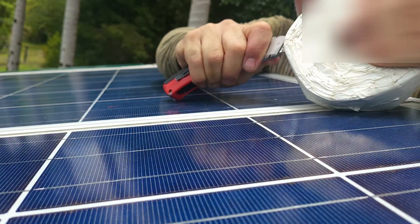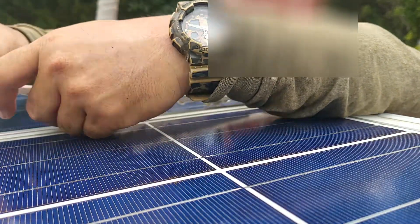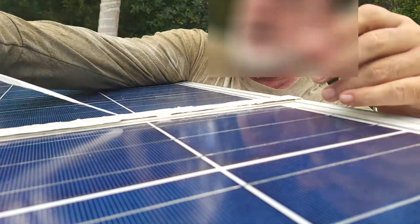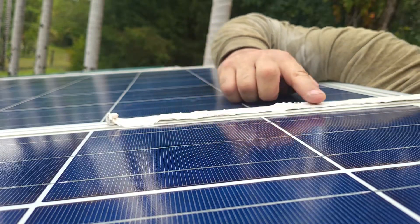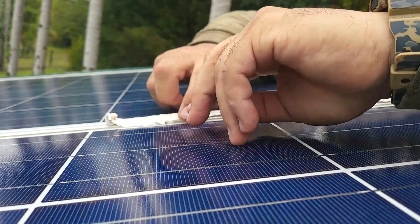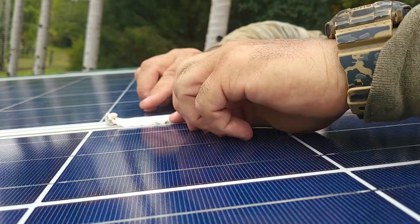What I'm doing is taking this RV tape and overlapping the seam, running it down over that seam and just letting it stick on there. This tape has a paper backer. I'm coming in and peeling this tape down until it's touching the glass part of the frame but not covering up any of the cells. I'll just pinch it down on the sides like that.